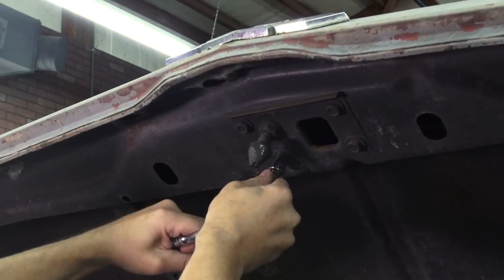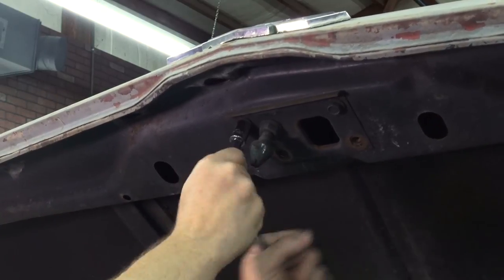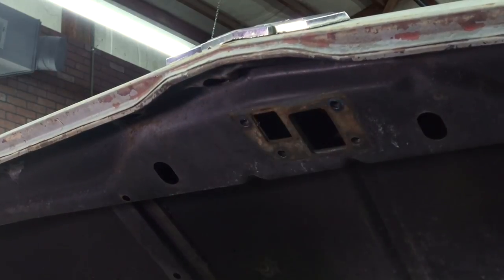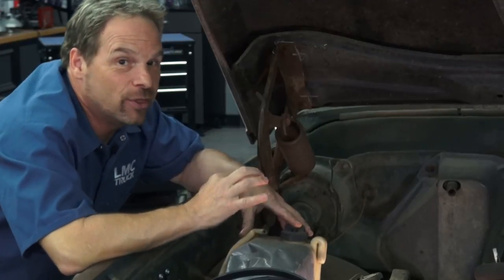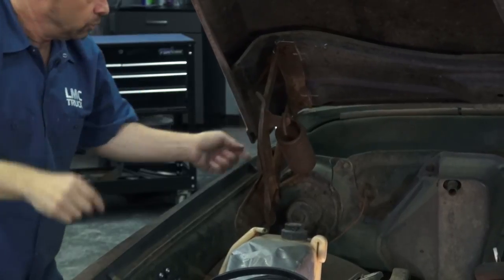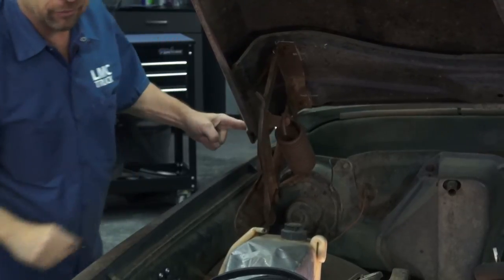This is important — remove the striker pin from your hood. The latch can guide the hood into a different direction and possibly damage the paint. Removing the latch helps you see exactly where the hood falls naturally. There's one more thing I want to show you about these factory hood hinges — this is not something you will see with the billet aluminum hinges. Look at this hood wobble. That corner on that fender could be really bad. I'm glad to say goodbye to that forever.